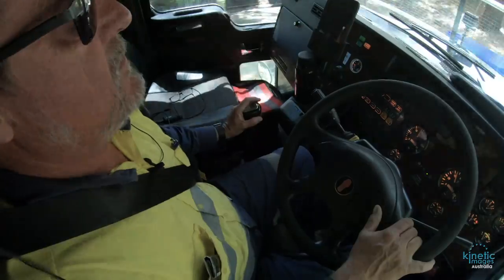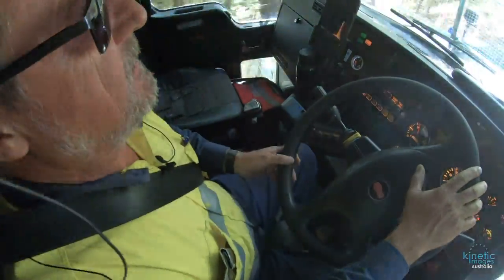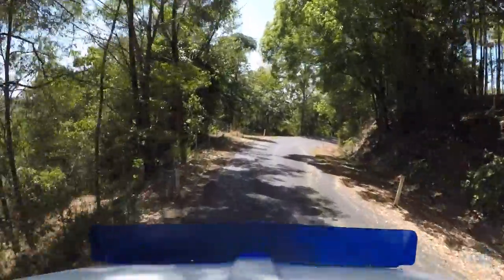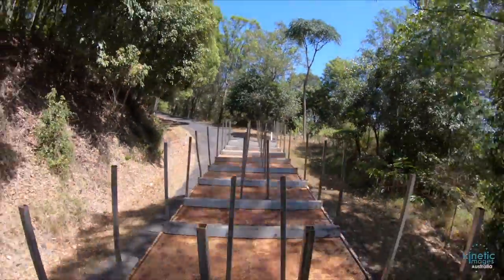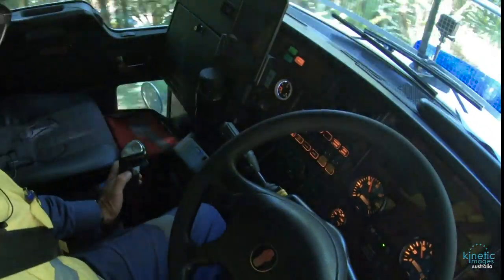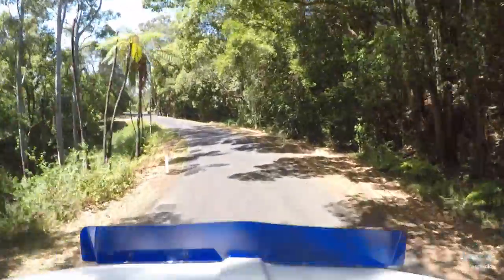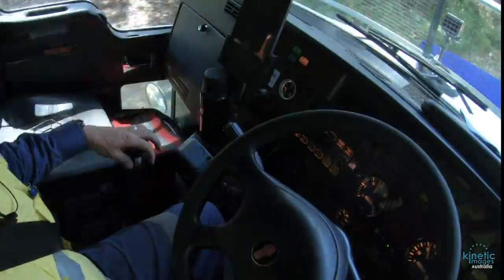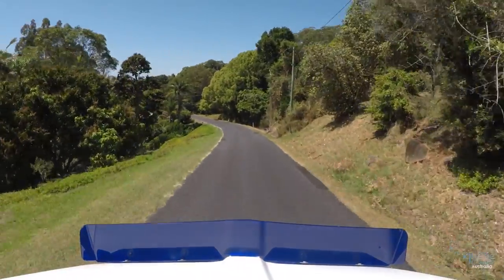If you were to ask me what gear I'm in — bug it if I know. The actual number of the gear I don't know half the time, and really it's irrelevant. What I need to know is by feeling — by my pants in the seat — I can feel if I'm losing speed and need to downshift or gaining speed and need to upshift. By putting my finger on the splitter, not even looking at it, I can feel a groove at the back so I know it's in the forward position and in a split gear.